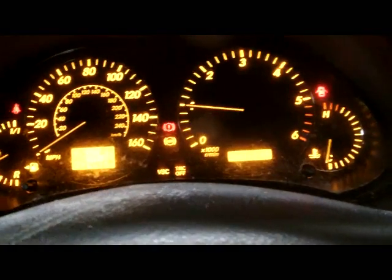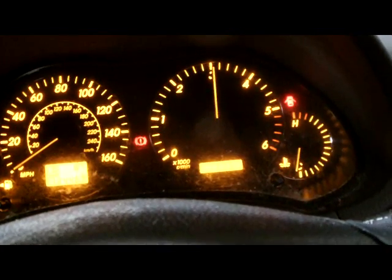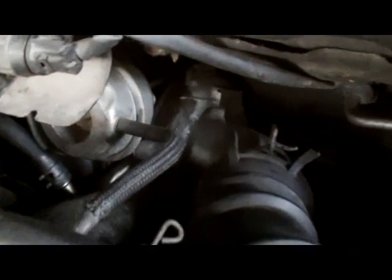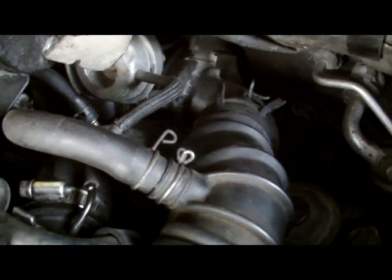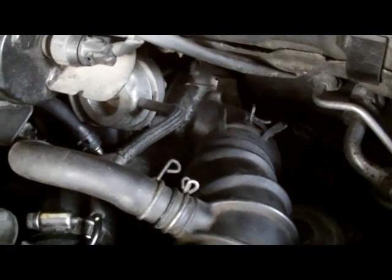In this video clip we've got a Toyota D4D and a faulty turbocharger. We have a burn on the turbocharger, so the next step is to pull off the ducting pipe here and just reach in and check the burn on the fan, on the vanes on the turbocharger.